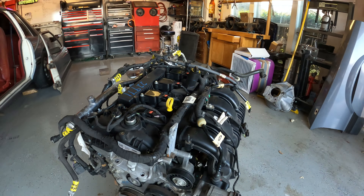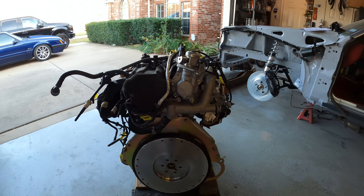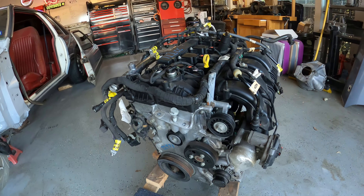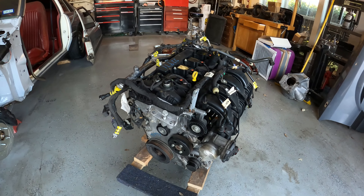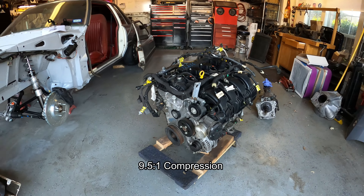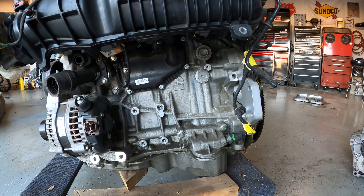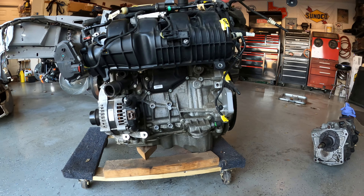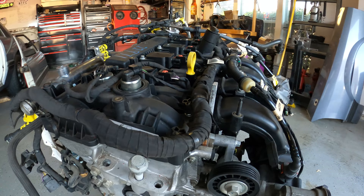This motor derived from the Mazda and Ford collaboration 2.0 liter motor but is different in many ways. The block is all beefed up to handle the extra torque and horsepower from the turbo. It's got a forged crank instead of a cast crank, and the extra 0.3 liter comes from the longer stroke. The bore is the same as the Duratec 2 liter. The block is high-cast aluminum, lightweight with extra ribbing for strength, a deeper sump oil pan, and a high-pressure, high-volume oil pump with piston squirter coolers.